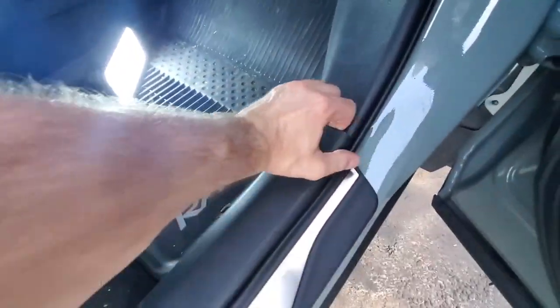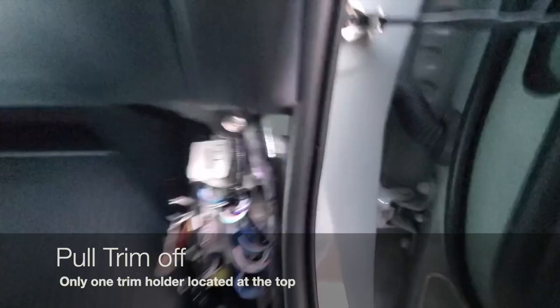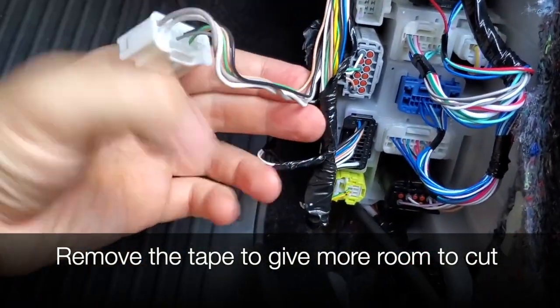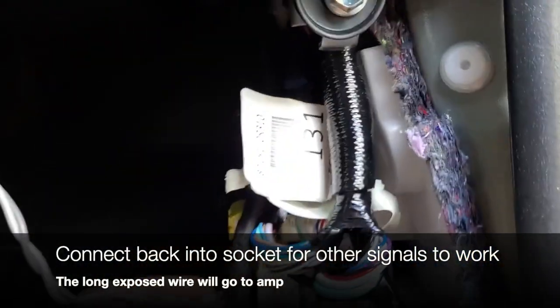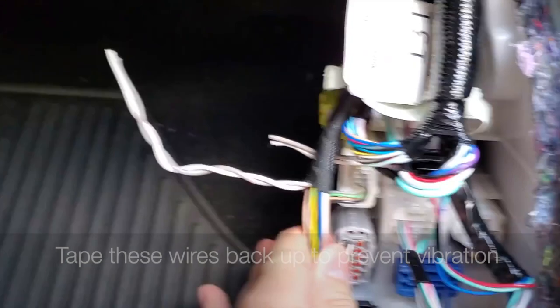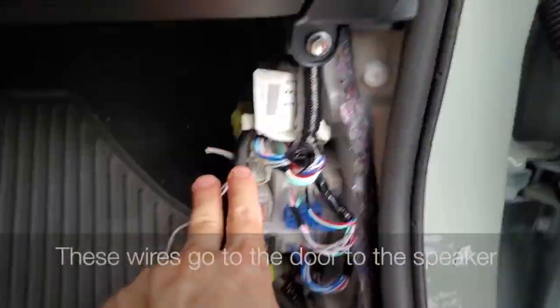Now we need to disconnect the dashboard speakers from the front doors. We remove the trim from the side — the wires going to the doors are behind this compartment in the corner of the RAV4 footwells. We unscrew by hand the little piece that holds the trim in place, then the entire trim pulls off with one clip. We unplug the connector and cut these two wires. To give us more room to work, we peel away the tape, cut the two wires, and connect it back to the socket. These long two wires go through the frame of the vehicle into the door to our speakers, and we will connect the amplifier to them.